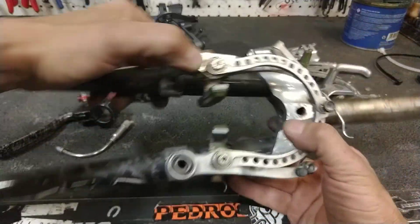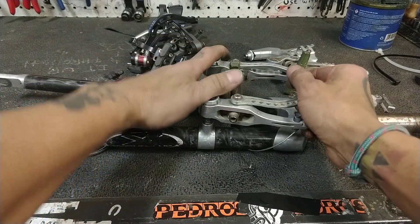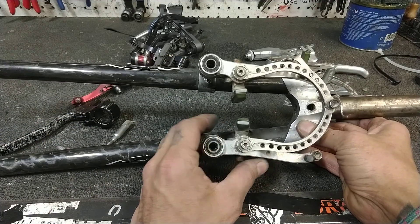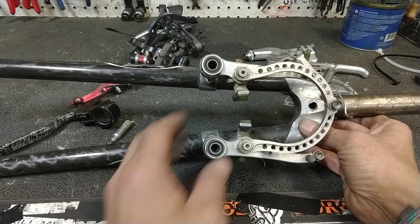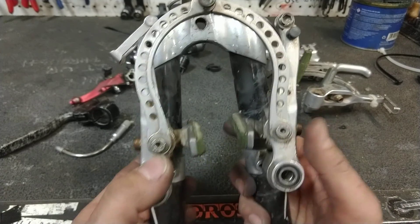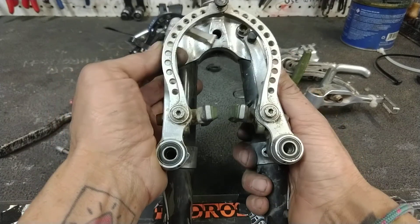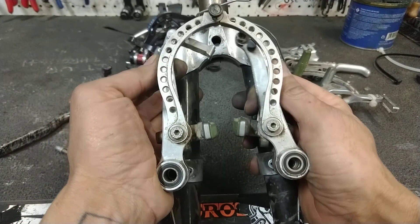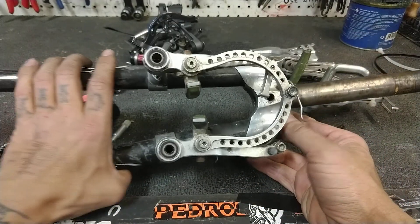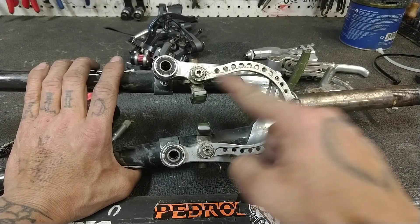What these are, I am sure, are an attempt to offer equal braking power to Shimano's parallel push brakes with similar features, but not infringe on any of Shimano's patents. So it's a totally different way of achieving the same effect, where the pads come in straight to the rim. These are really strong brakes as well because they've integrated a brake booster arch into the assembly.